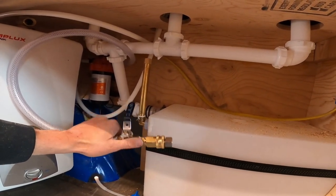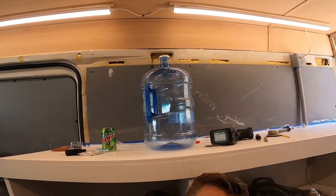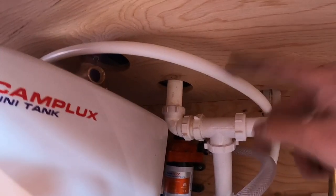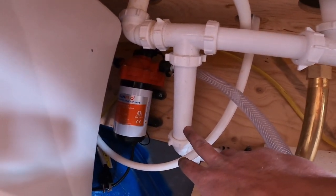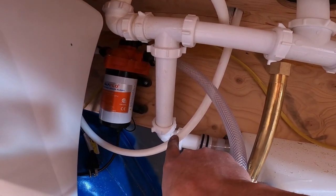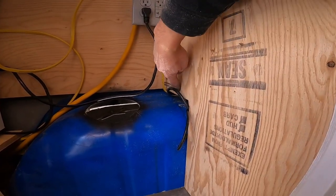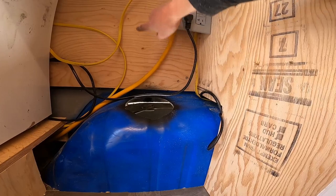This goes to our supply line, which will just be a 5-gallon water jug. Like that one right up there. We're gonna do a draw straw on the lid. So at this point, we have to tee off of this line here and send it to the other faucet. And then this is our hot water feed. And then this is our cold water feed down here. So we'll tee off of it and then run it out too. And I think that's our easiest bet, is to just throw some PEX tees on these and then just send two lines heading down through a hole or this gap, depending on what works best. And then we'll just bring it up, probably throw a couple more 90s here, and then just bring it up.